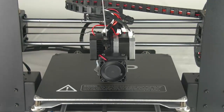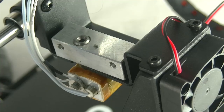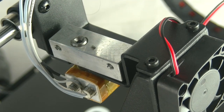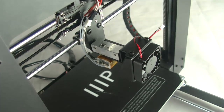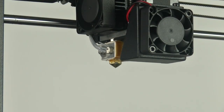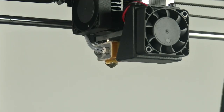This video presents step-by-step guidance on cleaning the nozzle of your Monoprice 3D printer. Among common problems caused by 3D printing, the nozzle becoming clogged is caused by the filament being unable to be fed to the nozzle. We recommend purchasing a 0.4 mm drill bit to clean the blockage and tip off the nozzle.